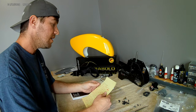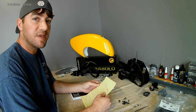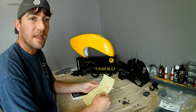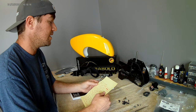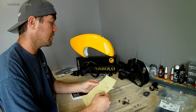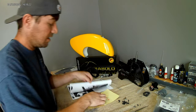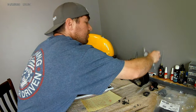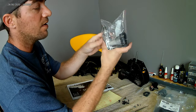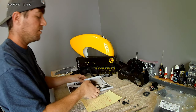When you go to place your order for this kit, you need to be aware that it has an engine-specific clutch. You need to specify which engine you are going to be running. The clutch actually threads onto your crankshaft, and OS and YS have different crankshaft threads, so you will need to specify your engine upfront.